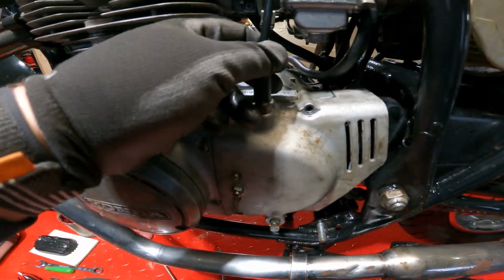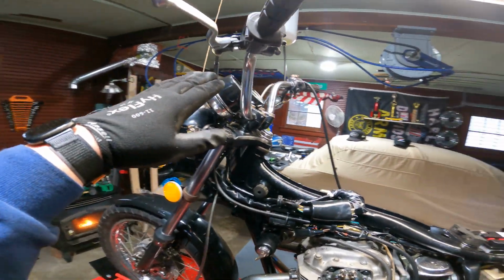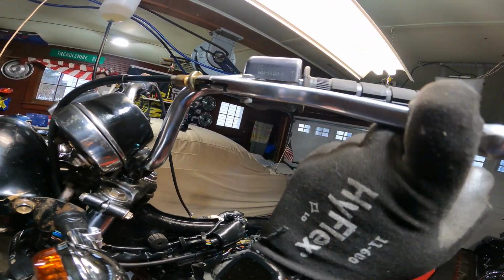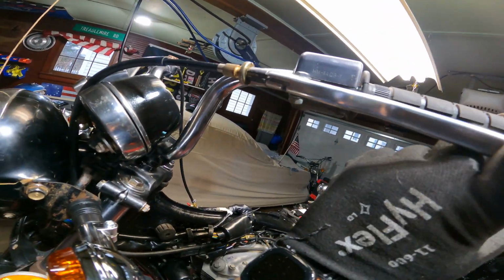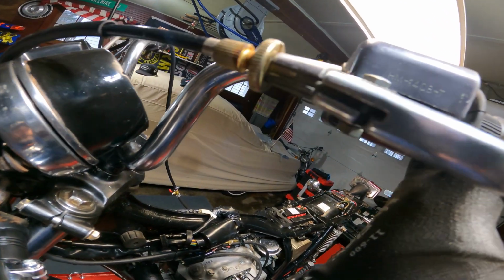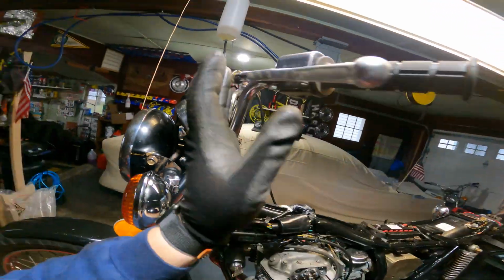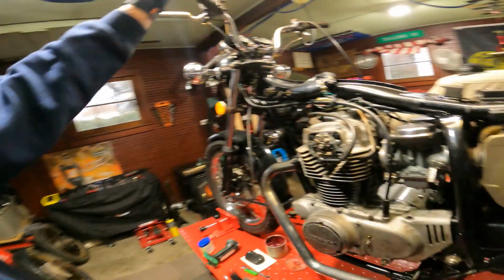So this is on, hooked up. We're set halfway, and you got a little bit of play in your cable. See how there's a little bit of play in there? You want a little bit of play, okay? If you're one of the people that don't want any play, well, don't ride a CB360. You want a little bit of play there. It'll help you out in the long run. It'll make sure you don't get the clutch pop.